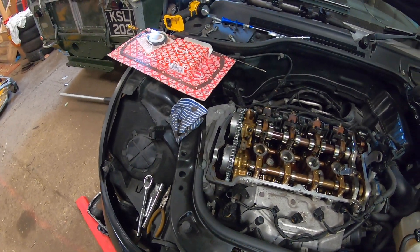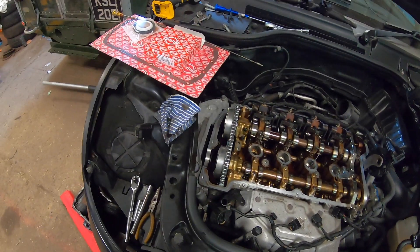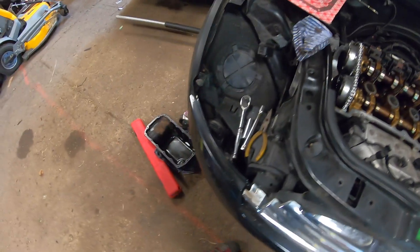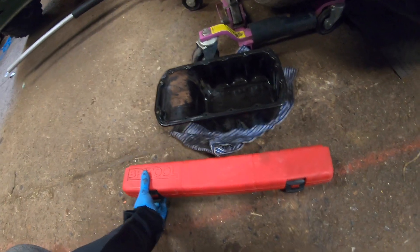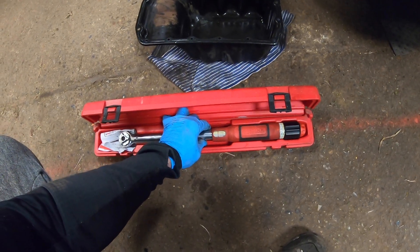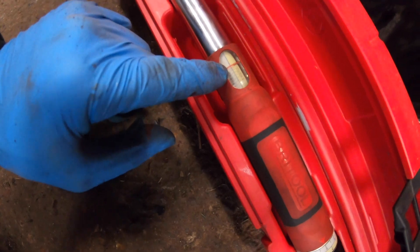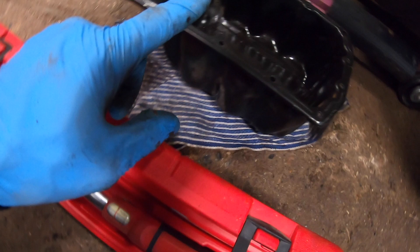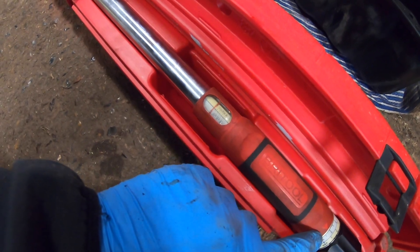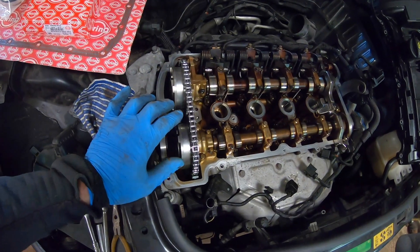The torque wrench I have - I think it wants like 0.6 or 0.9 Newton-meters on the pre-tensioner. That's not really going to work for me. It says on the instructions it goes from 20 up, but as you can see it's gone right down. With the dial here it's sitting at 9 at the moment because I started at 20 and went back 11 - that's what the sump needs. I can't put the sump on yet so we'll see how much further this goes back. Anyway, the next thing is start tightening everything up and putting everything back in place.